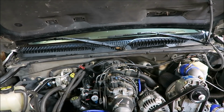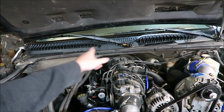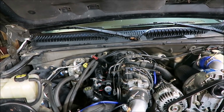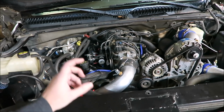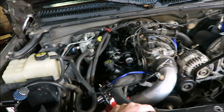First and foremost is the exhaust leak, which I think is going to be a little bit more of a pain in the butt. It's the bolt closest to the firewall on each side that broke off. So I think I might have to pull the heads, which is just really, really inconvenient. And then we'll throw some new exhaust gaskets in it. I'm going to get some OEM MLS gaskets, multi-layered steel. Those seem to be the preferred one.